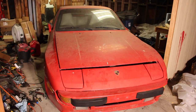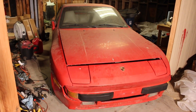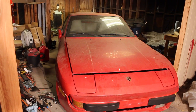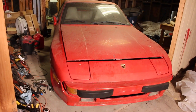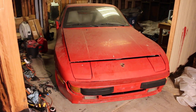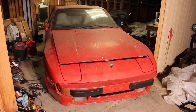Well, that's a wrap for this video. We couldn't get it running but that's okay — getting an old car like this running isn't always the easiest thing, and I'm just trying to show all the steps involved. So we've gone through the fuel system, made sure that the fuel pump is there, replaced the fuel filter, got new gas in there, replaced the oil, replaced the oil filter, put in new spark plugs, put in a fresh battery — so we've got our basics covered. Next video I'll be troubleshooting and running some tests, checking fuel pressure, making sure all the fuses and relays are good, and then we can hopefully get it running the next time. Thanks for watching and tune in next time.